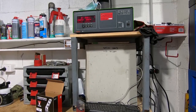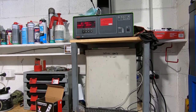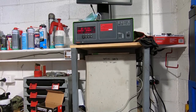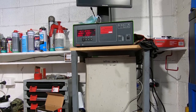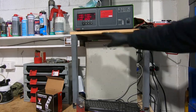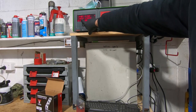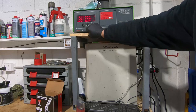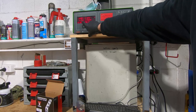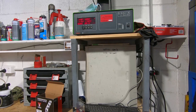Okay, so I'll take it over now and plug it into the horizontal header takeoff. So we're plugged into the horizontal cylinder. And it's not too bad, really. What we're looking for is the carbon monoxide, CO, which is this number here. This is the hydrocarbons, and this is the oxygen. Hydrocarbons and oxygen are a good indicator of how clean it's running. 344 parts per million at 1.2% is nice. And 4% CO on a bike of standard mufflers is also really nice.